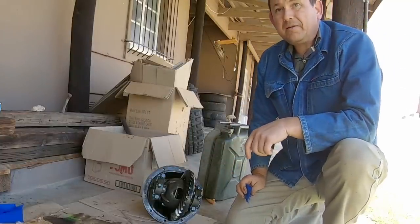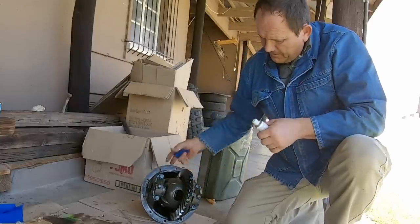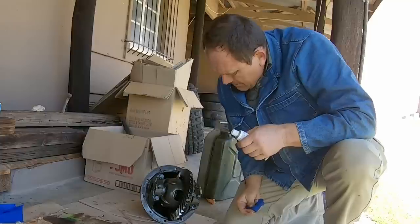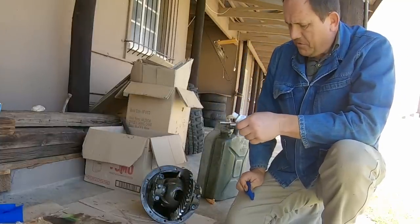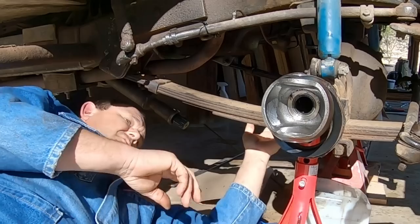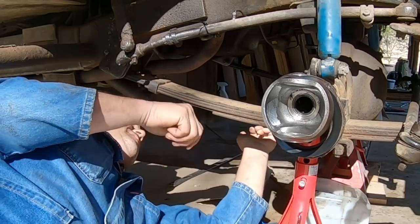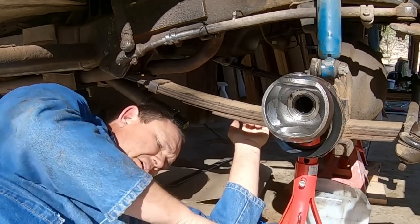lying on my back under there. This is quite heavy, manipulating this into that. I'm gonna have to see how that goes. I've got both surfaces that need the gasket maker clean. Just wiped, cleaned with petrol and then wiped with an acetone rag.